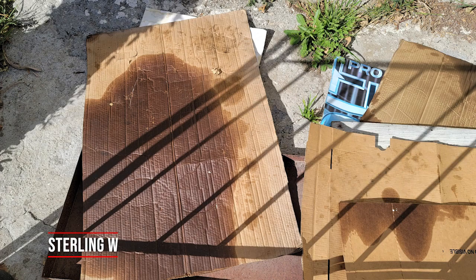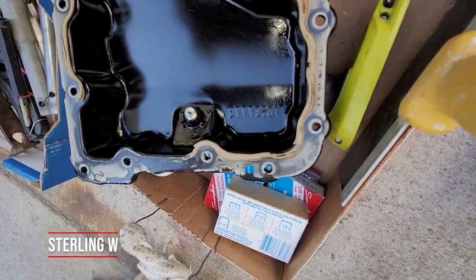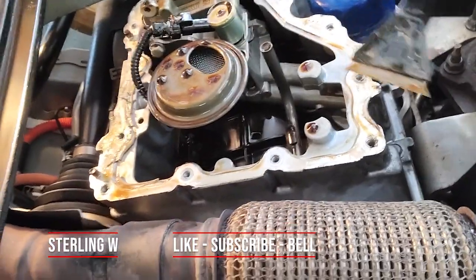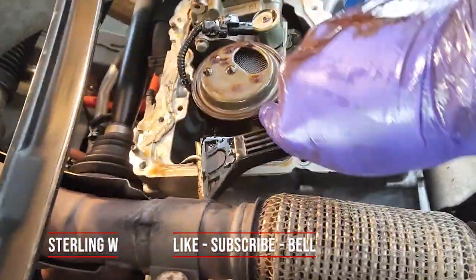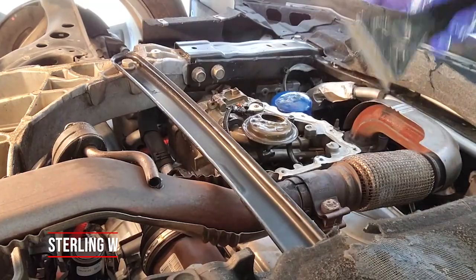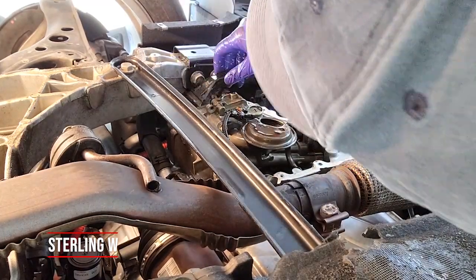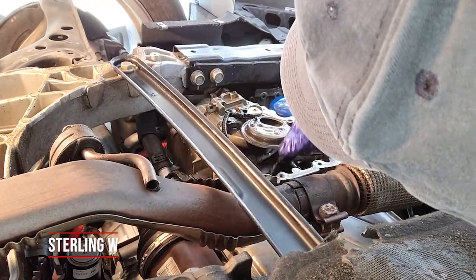Just be careful — this is not a how-to, just my experience. There are plenty of oil pan change videos on YouTube. As you can see, I'm scraping with a razor blade, but the best thing to use is actually a plastic razor, since what you're scraping against is probably aluminum and you don't want to scratch it. I'm carefully scraping off the old RTV silicone.